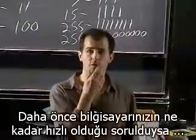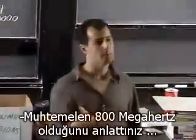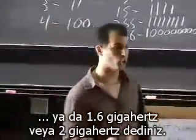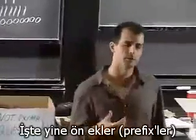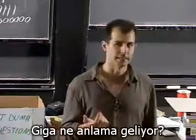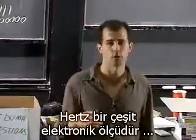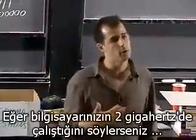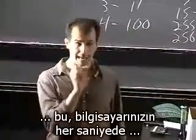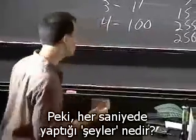Megahertz or gigahertz. So if you've ever been asked how fast your computer is, you've probably been told it's 800 megahertz, or 1.6 gigahertz, or 2 gigahertz. Well, there are these prefixes again. What do we mean by giga? Billion. What's a hertz? Well, hertz is just an electronics measure, something per second. So if you say that your computer is operating at 2 gigahertz, that means it can do 2 billion things per second.